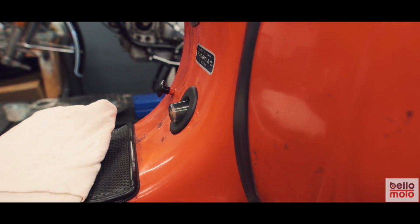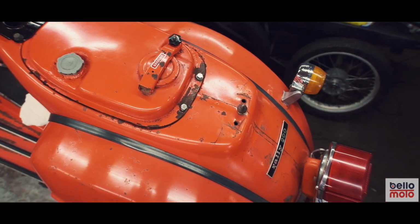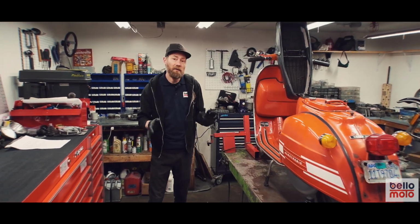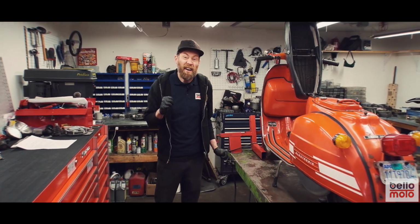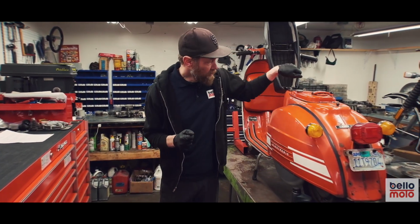So this will mix automatically at 2%, which is also what most rotary valve Vespa models are recommended to be mixed at. So that's like a 50-to-1 ratio, or maybe like 2.5 ounces to every gallon. So you'd add a gallon of gas.